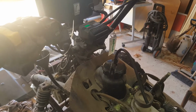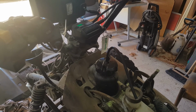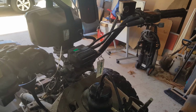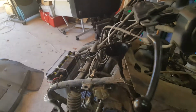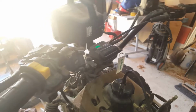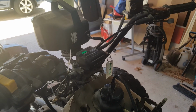I'm going to stop there because I might try and use two hands to see whether a bit of throttle or a bit of choke or what is needed. It may potentially be, look, all of that fuel's run down. If it's all just running freely into the cylinder, it'll be flooded, I don't know, so let me have a play.